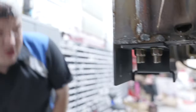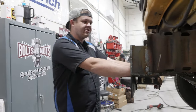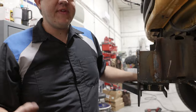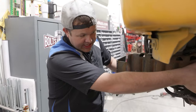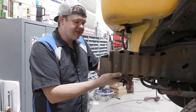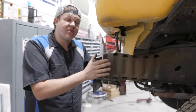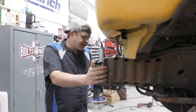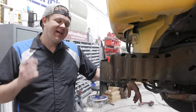Basically what we've done is we've now created an I-beam — we've tied both frame rails together so that when you're winching, you're actually winching with both front frame rails. On another video on our channel, Robbie Layton Nation, you can watch us fish plate this. We're going to be adding a plate all the way on the outside that ties the bumper into the frame and into the winch plate, making sure that if you get into trouble and need to winch out or be pulled out, you're not going to rip the front of the frame off.